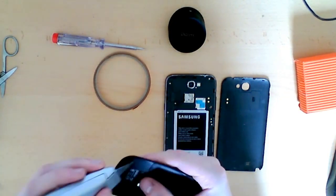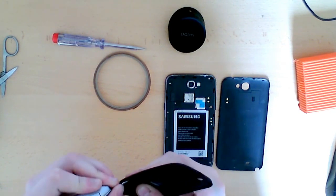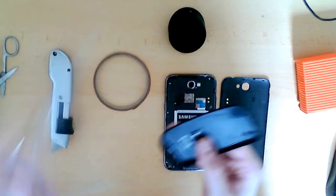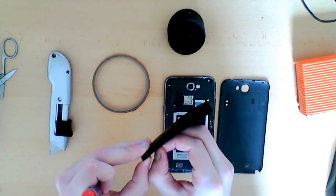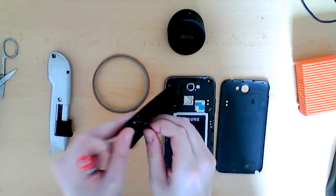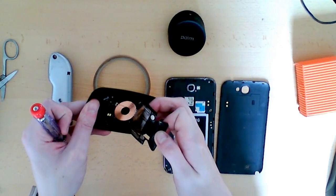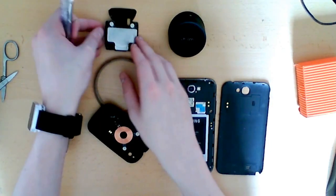What I did was use the back edge of the Stanley knife just to lift the corner of the black plastic film that's holding down the element. You've got to be careful because you don't want to chop anything — just peel it a little bit, then use the screwdriver to pry the rest up so you can get your hands in and pull it off. Pull it carefully; you don't want to bend the element and break any copper wires. It only takes one break in that copper wire to massively affect your charging capability, if not completely remove it. That metal film piece inside — you need that, so keep hold of it.